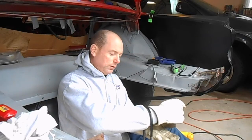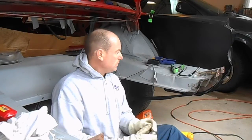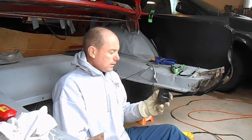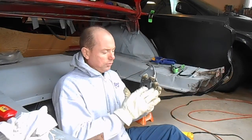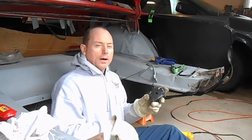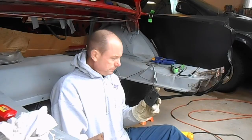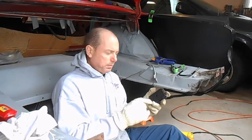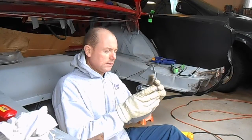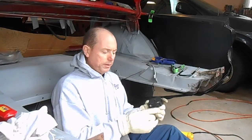You need some kind of filler to go in between the leaf spring and the bottom of the axle. So what I did was weld up this little block. The welding is kind of ugly, but it's going to work — it's the right thickness. I put a hole in the bottom of it to match the hole in the bottom of the plate that holds the leaf spring to the axle. The plate has a little post on top which I also added on. I'll give you a close-up of this — it has a pin on top and a hole in the bottom.